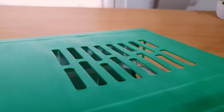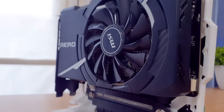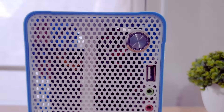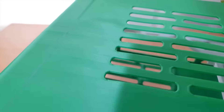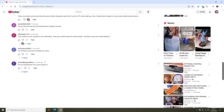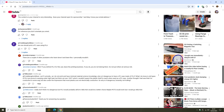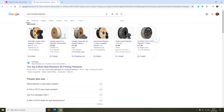I was able to stop it by pulling the soft plastic away, and this is the result — obviously it's pretty bad. The GPU side was fine; I'm using a graphics card with horizontal cooling which directs exhaust sideways and out, working well with this design. But the CPU side is more restricted. I'm experimenting with hiding the power button to create more exhaust area, but regardless of any airflow optimizations, it's clear that PLA isn't good enough. There was debate in the comments over whether PLA is acceptable, but the obvious solution is to switch to a more heat-resistant plastic.